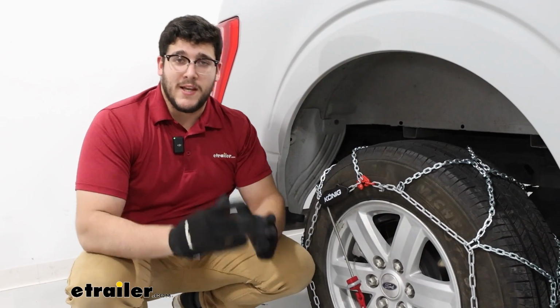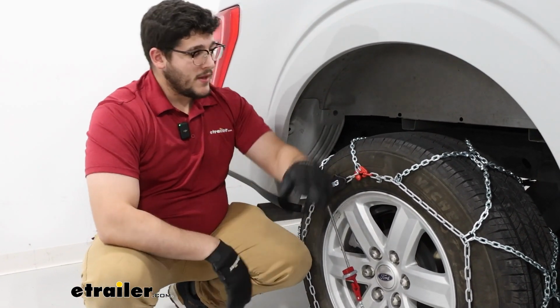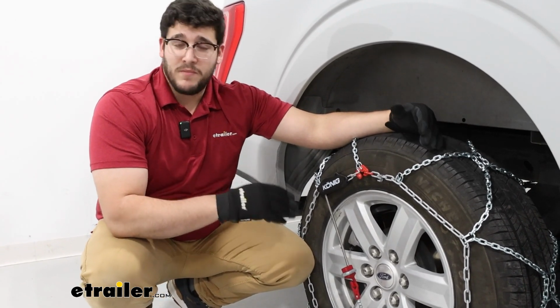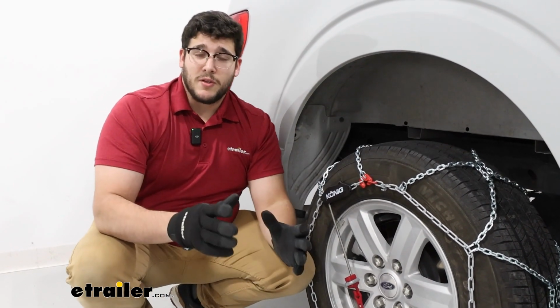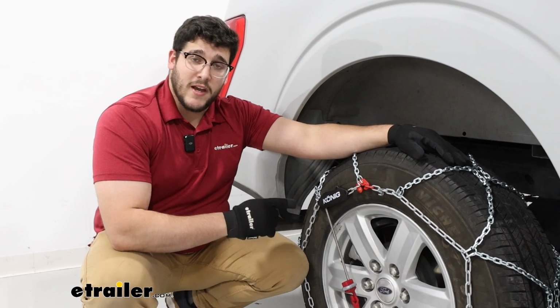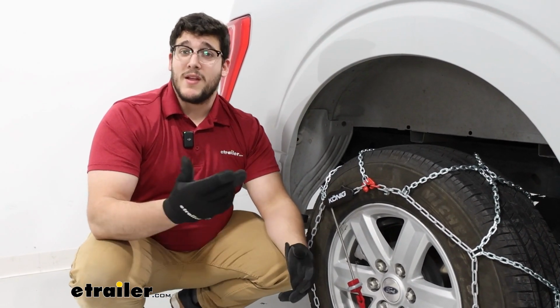With both chains in place, I recommend either pulling forward or backing up some, checking your chains, making sure they look good, everything's well seated, and if it is, you can take it out for a ride. But that's just a look at the installation and some of the features of the Konig self-tensioning tire chains on a 2023 Ford F-150. Thanks for watching.